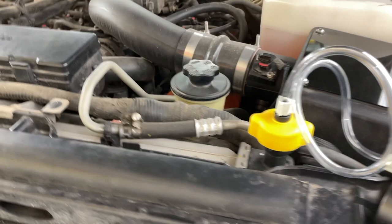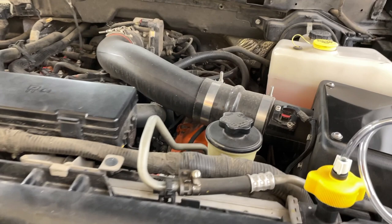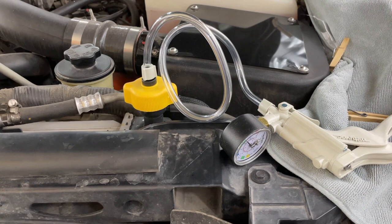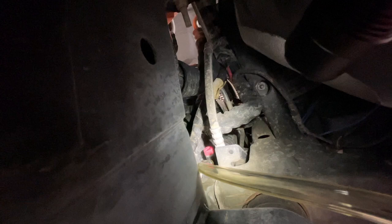I think we're going to be good to go. Any thought I had of the head gasket being potentially compromised from overheating is pretty well alleviated at this point. I'm going to leave the pressure tester on for about a 10-minute total time period just to make sure it doesn't leak down. But I think it's safe to say it's time to start tearing into this thing. The coolant pressure tester is now off the truck — you push the release valve, let all the pressure out, take it off, clean it up, and we're ready to start taking coolant out of the system.